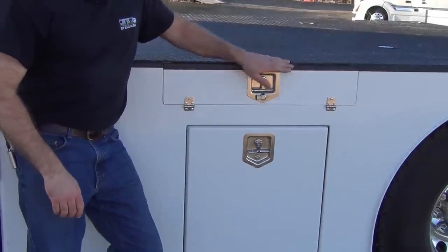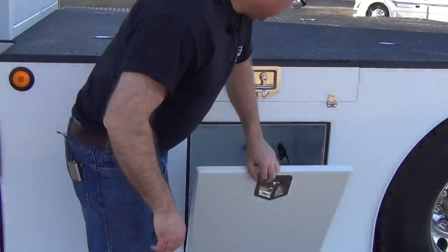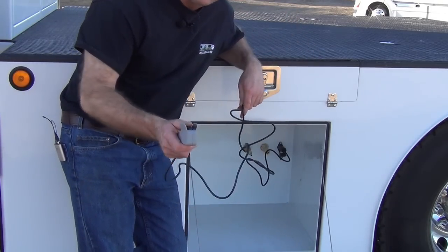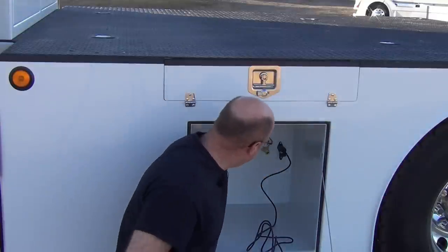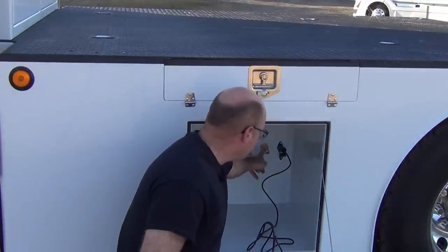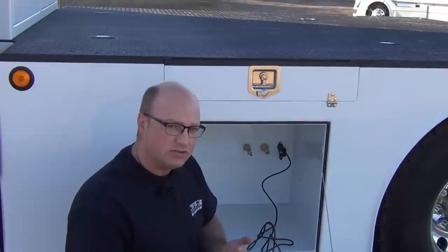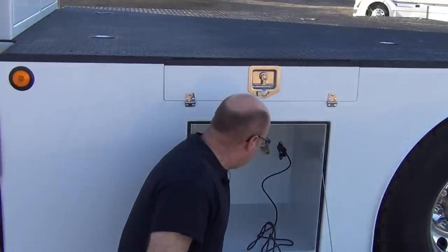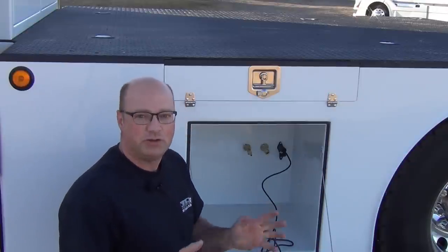Here on the driver's side of the bed, this box is where our ramp gets stored, and this box is storage. We have two winch controls, one on each side of the truck. A functionality change we've made are these two airline connections — one outgoing and one ingoing. One allows you to air the tanks on the truck when you need to get into a tow situation, so a tow truck driver can provide air and disengage the emergency brakes. The other is where you can attach your coily cord for airing up tires or beach balls.